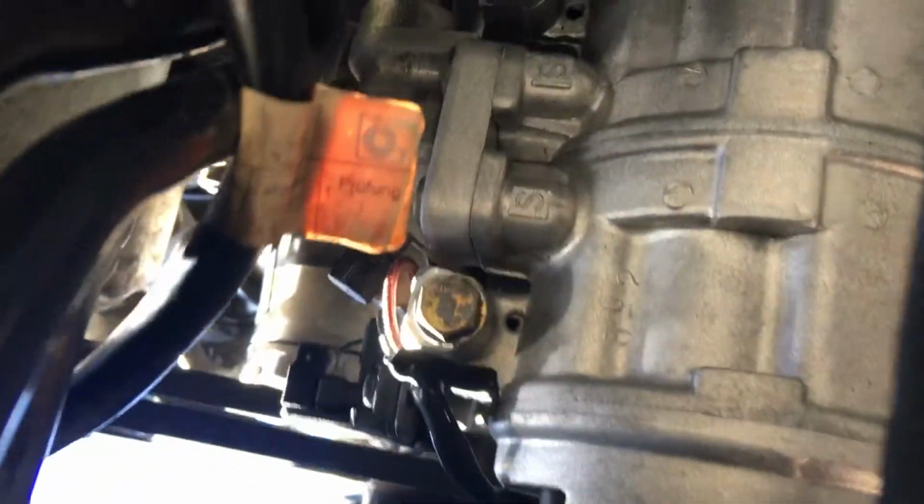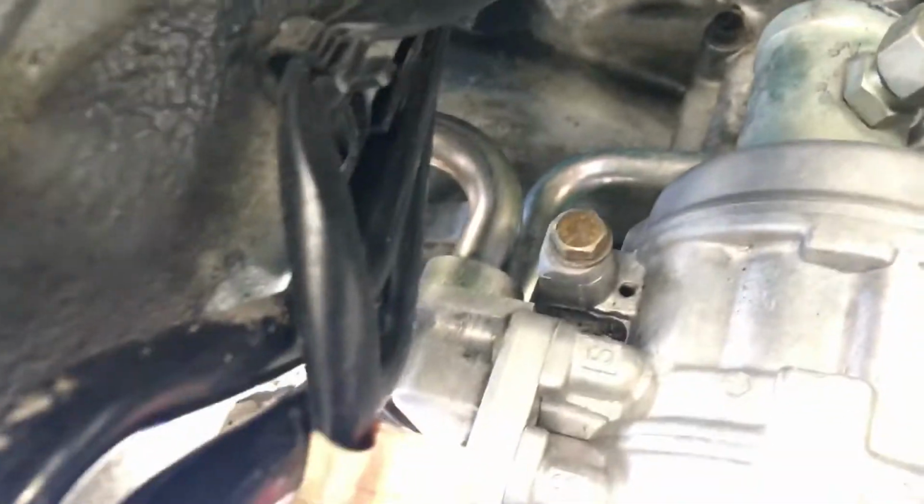Maybe I got lucky and I could see under the compressor it's dirty. Look how clean that compressor is. You can eat off that compressor, it's so clean. If I had failing gaskets up there at the top manifold where the hoses go in, there's no evidence. He literally cleaned it so good. I can't find any. If the front shaft seal was leaking and throwing oil all over the place, there's no trace on the side of the frame rail or anything. Yep, he did a really good job of cleaning. That makes my job harder.